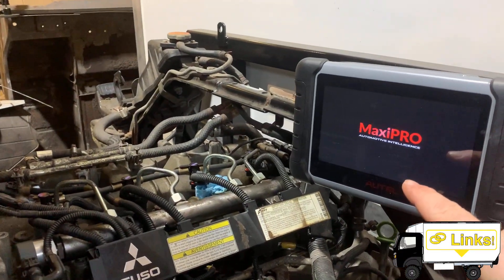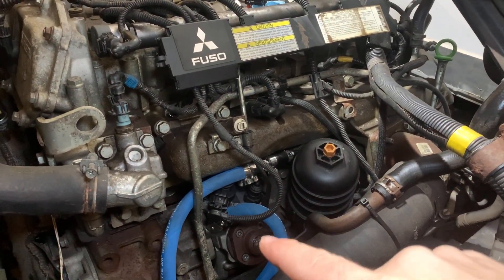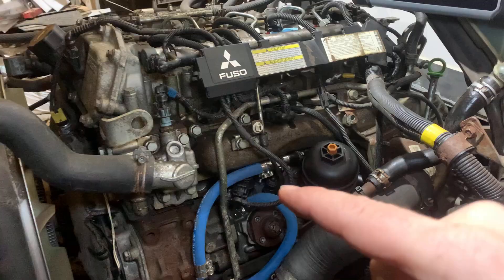I am by no means expecting either of those things I've done to allow the truck to start, but they were both things that I needed to do and wanted to check. I'm going to turn the key, let the fuel cycle through, and give it a crank. I don't expect it to start. I'm also going to have my scanner hooked up to attempt to read fuel pressure, just in case there's a spike in the beginning and then it drops off. I'm pretty sure this is going to make no difference at all — I think that pump is euchred. I'm also going to listen for whether cylinder number two is quieter now, since there was clearly some compression escaping before.